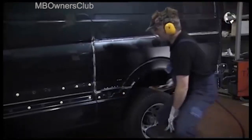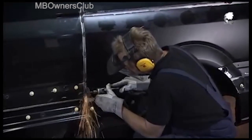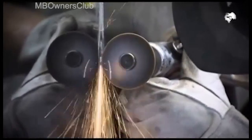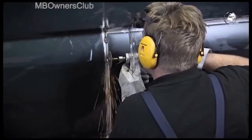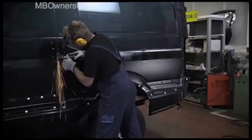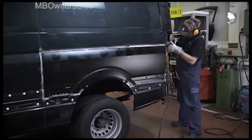After painting, this join will be filled with the black sealant used previously. The sealant completely covers the weld points. As such, work the weld points so that they do not protrude. The rear weld points also have to be cleaned so that they do not impair the installation of the tail light.